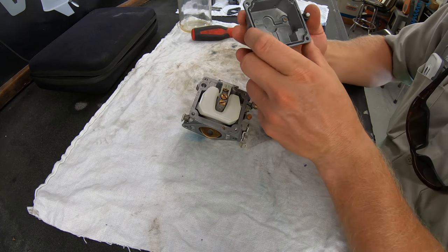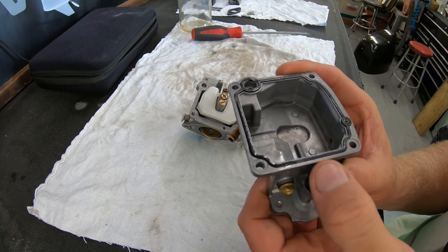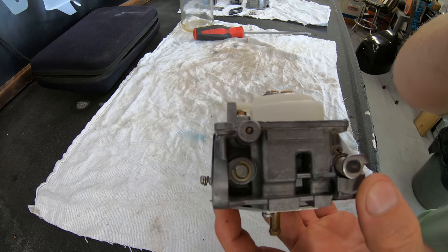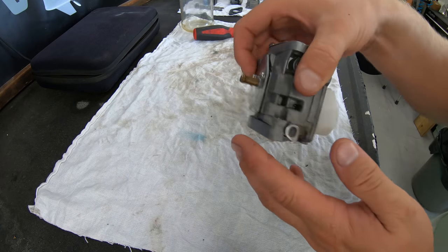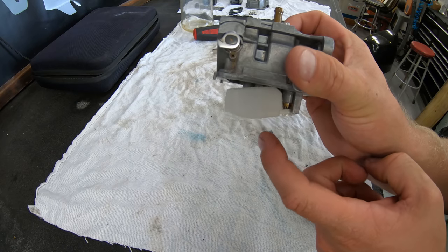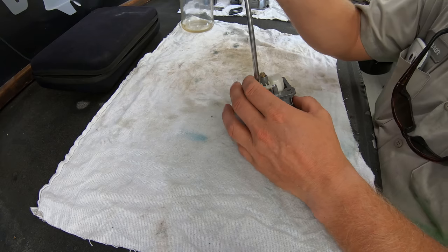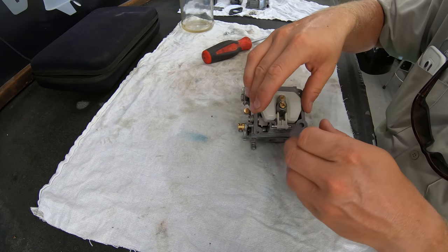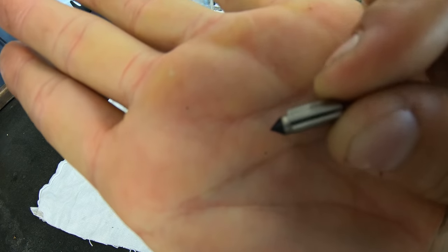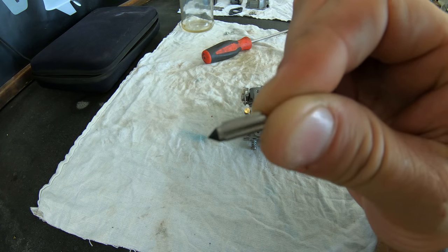We'll start by pulling the bowl off the bottom of the carb. For this engine the bowl was actually really clean with not much to see in it, and the six horsepower wasn't that bad either. Your carb might be a lot dirtier than these. If you have a plunger pump on your carb like this, make sure that it pumps clean. Set the bowl off to the side and check the float needle valve next. Most carbs have the same float setting — flip the carb upside down to check it. The float should be even with the side of the carb, so that when the carb is full, the float will float up, shut off the needle, and stop fuel from flooding out. After pulling the float needle off, check the needle tip to make sure it is not rounded over — you want it to be in the shape of a triangle.